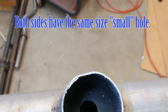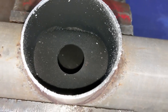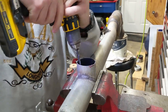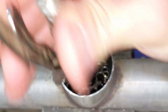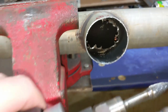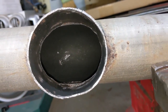Now for the million dollar question — look at that. To open this up, there are probably many ways to do it. I'm going to punch and drill a series of holes around the perimeter, and then use the vise grips to bend each piece of metal out of there. This is what it looks like when I'm done drilling. Now I'm going to use the die grinder to finish it off. And there you have it — the finished product. Obviously a lot more flow. Hopefully that will translate into a better sound and a little more power.